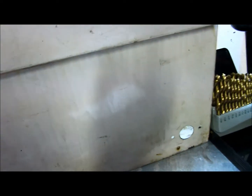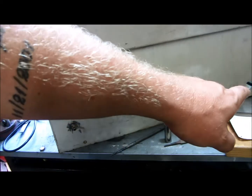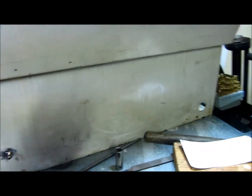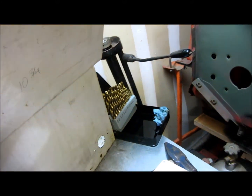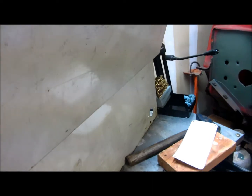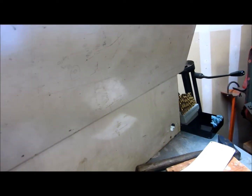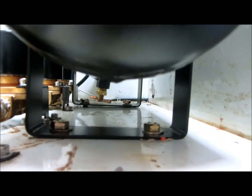Next I think I'm going to either work on the wiring or build a plate for this hole. I forgot I had some hole saws over there I could have used, but no big deal, it's done. I'm going to build a little plate that'll go on the inside, on the back side, for the bolts — just because it's a little thin here when I'm pulling that plug in and out. I don't want to bend or rip anything, so I'll build a little fish plate, through-bolted, not welded.